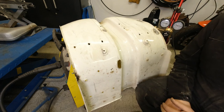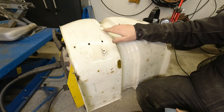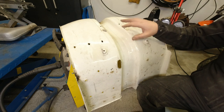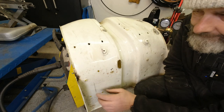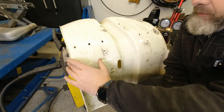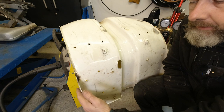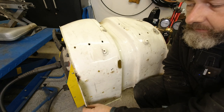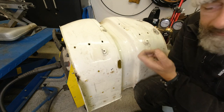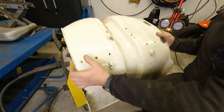That is about as good as I can get it. I have welded up all these holes and I've used my little mini grinder to flatten it back out again. Some of the holes went well, some of them didn't. The split on the corner here — what I ended up doing is building up a bead on the backside there, just to strengthen it a little bit and then reshape it. The edge — I managed to straighten this edge here. I used a smaller hammer and that flat bit of metal on the backside there. I've got most of it out — there's a tiny tiny bit there, but I'm pretty sure my painter will be able to sort that out with a little bit of filler. All in all I'm pretty pleased with that — it went quite well.